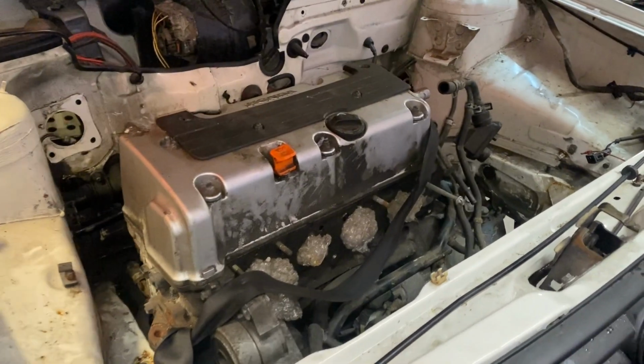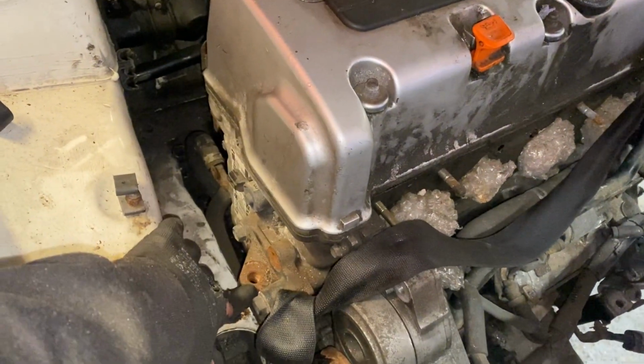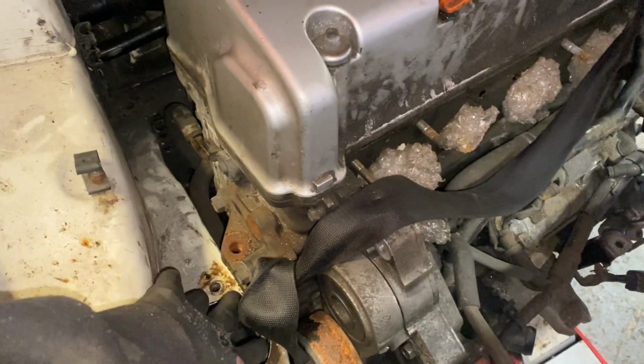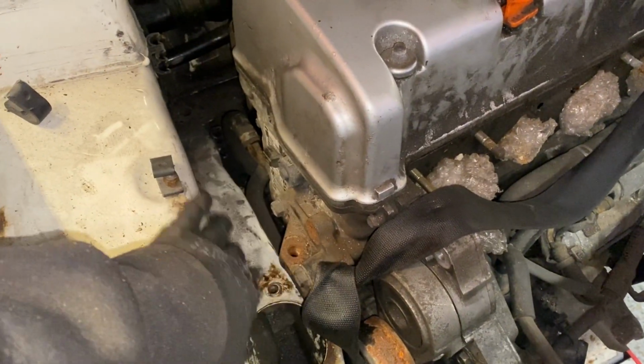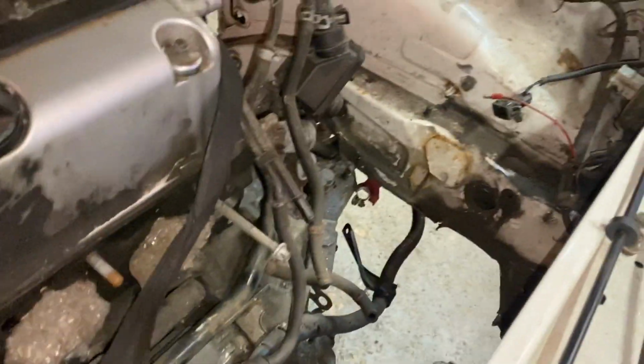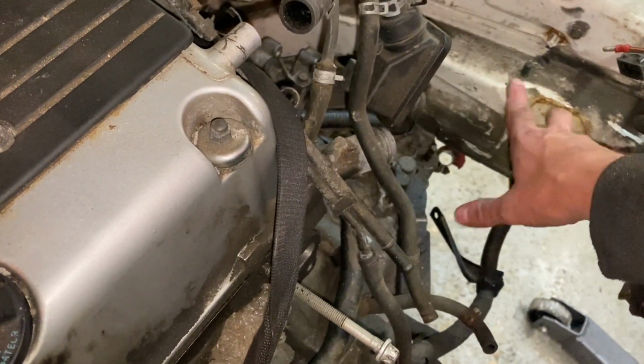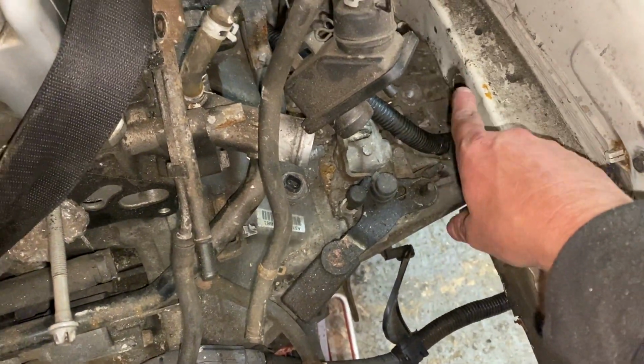Right, so it's not mounted, but we managed to get the engine crane out because it's sat on this mount here, which is a good thing really because the factory mount is here anyway, so I can tie it into this chassis leg. That's no issue. As you can see, I've cut all this away. I can rebox that, but that's just to get clearance. It does clear now in that hole, just enough.